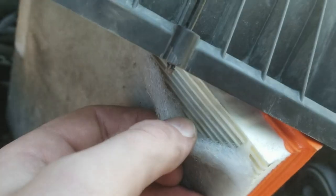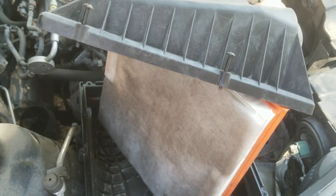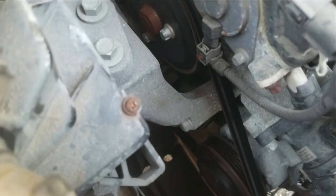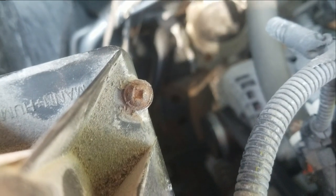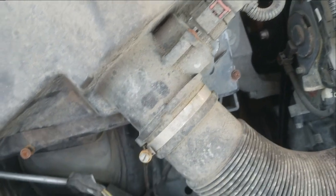I decided to look at the air filter too — it looks a bit dirty on top, but underneath it's still pretty clean, so it's probably still got some life in it. I'm almost up on an oil change, so I'll probably do it next oil change. Also, if you have rusty air intake bolts like I do — these two are pretty much rusted out so they can't be driven with a Phillips anymore — a set of right-angle pliers works great; you can just grab onto them and twist like a screwdriver to take them out and put them back in easily.